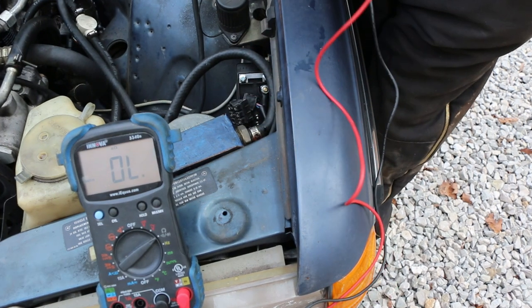Let's talk about what this means. Ohming out the plugs like this is not a surefire indicator of plug performance — there could be carbon buildup around the plug making it not heat up as well, and the age and brand of the plug can also affect performance. With that said, we know glow plugs one and four on my car are not contributing anything to cold start performance, because there's no heat getting into that pre-chamber. That tells us those plugs need to be changed. Let's move into the engine bay and change out glow plugs one and four and see how this car starts up.